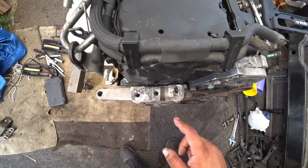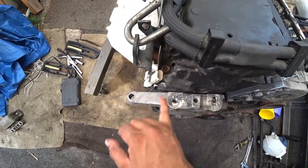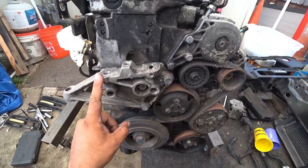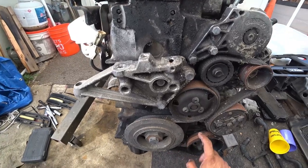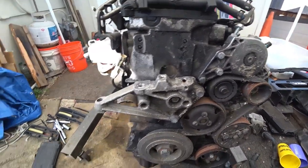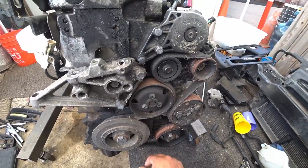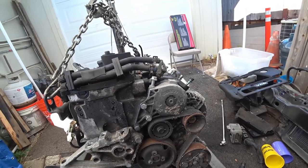The first problem that I just found was this right here — this main bracket is damaged. So we have to get this motor mount bracket replaced — this motor mount bracket has to get replaced no matter what. I see a lot of rust on the pulleys. That leads me to believe that this had a lot more other issues, not only just oil starvation possibly, but very very poor maintenance. You can see this belt is coming apart.